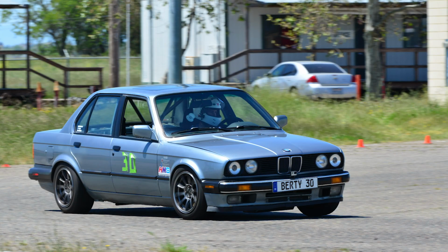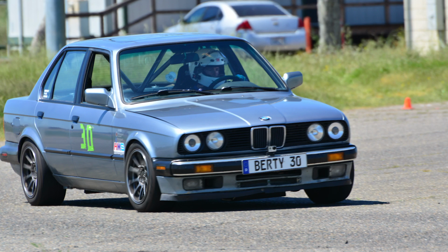However, for autocross and for track and stuff like that, when I'm really doing some performance driving with these really grippy tires, even with the sway bars, I still get a little bit of lean. Now, if you guys are just running regular street tires and non-R compound, I mean, these are 100 treadwear, freaking sticky compound tires, and I push the car hard. So I get a little bit of sway. I'll kind of insert a little still of where I really noticed it, but I wanted to basically up the spring rates on the front and rear.